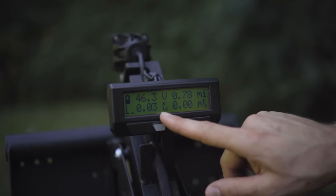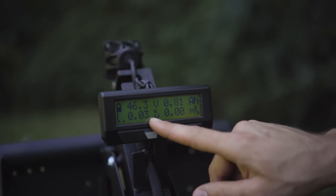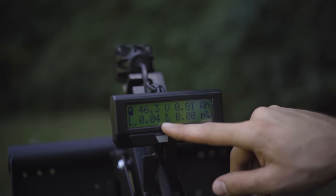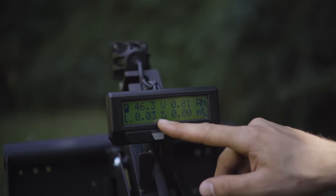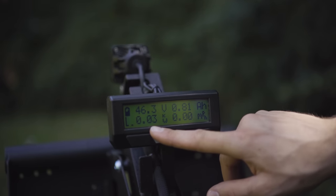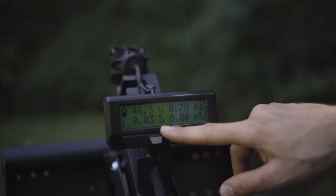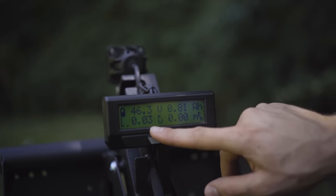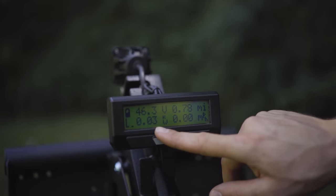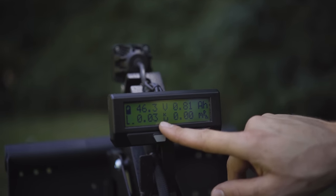Bottom left shows you the power used from the motor currently, instantaneously. So this is 0.04 kilowatts, which would be 40 watts of power, just standby for the machine with the lighting and everything running, the fans sitting here idle. If you're going down a big hill and you're on the electronic brakes, you'll see that go negative as it's putting power back into the batteries under that regenerative braking. Also, that'll go negative if you've got the Outrider charging plugged into the wall, or it would go negative if you had a solar panel connected to the Outrider that was charging the machine.